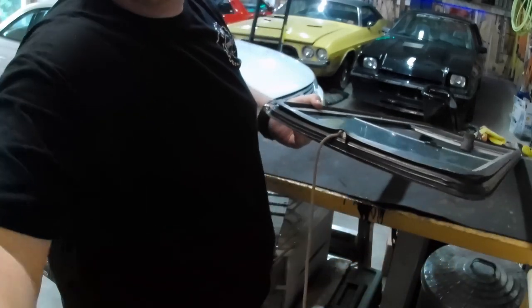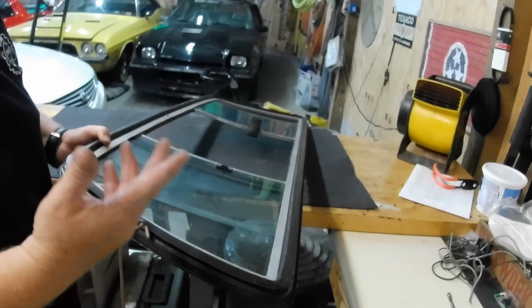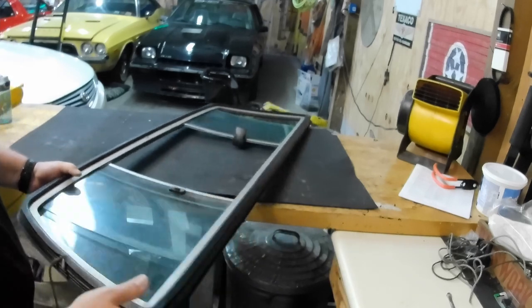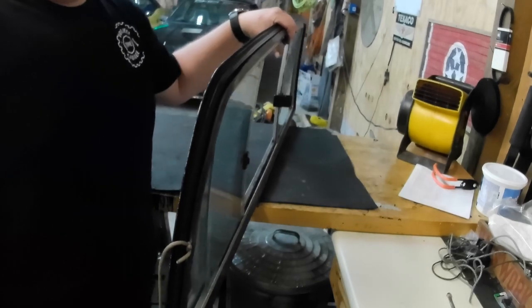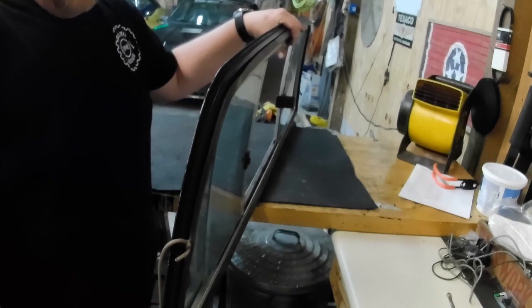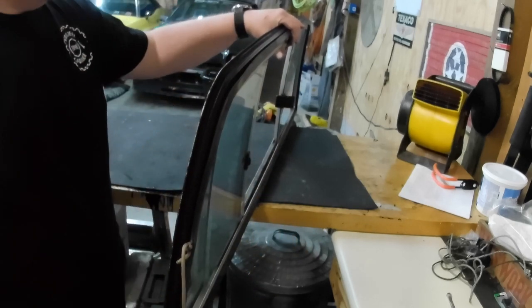You can see what I've got going on here. The knot's kind of buried. Obviously we're not going to try to pull this big knot across the pinch weld — we're going to work with this way beforehand. So the next stage of the game, let's get the back window out there and get it sitting in the truck so that it supports itself a little bit. Then we'll start the process of roping it in — pulling this rope to pull that lip through there.